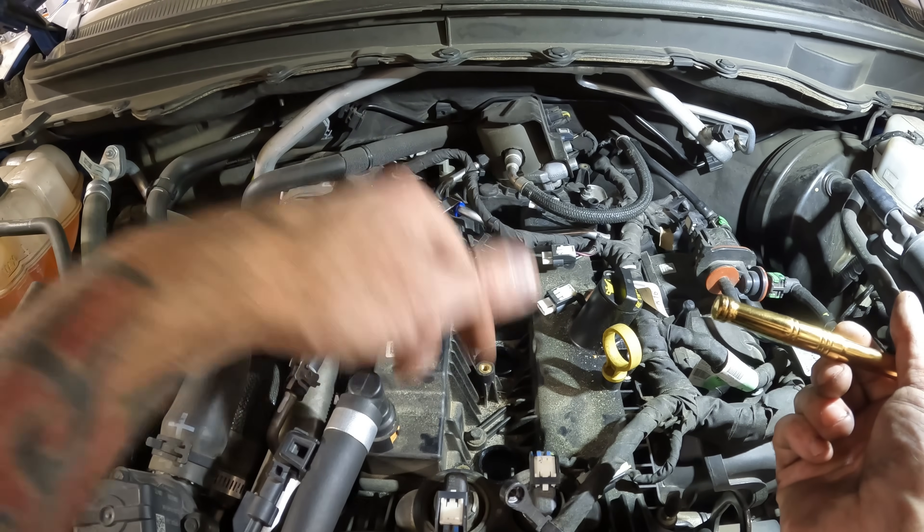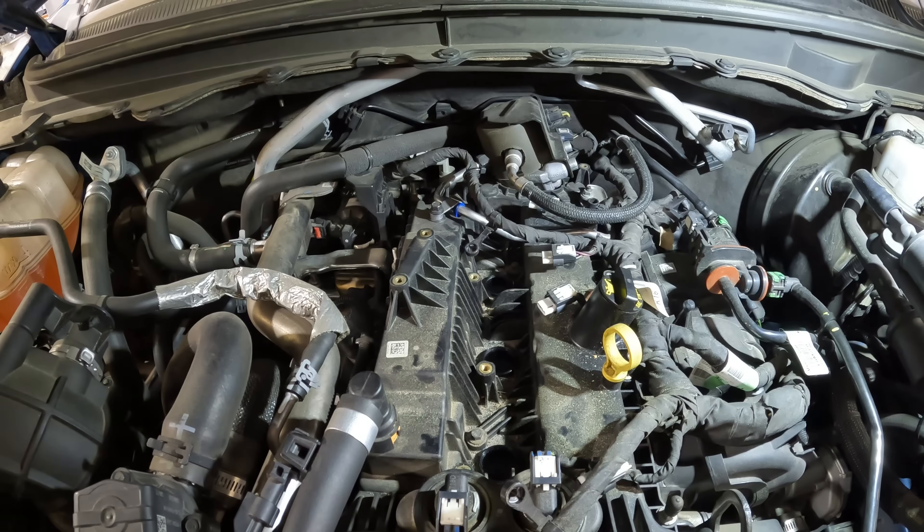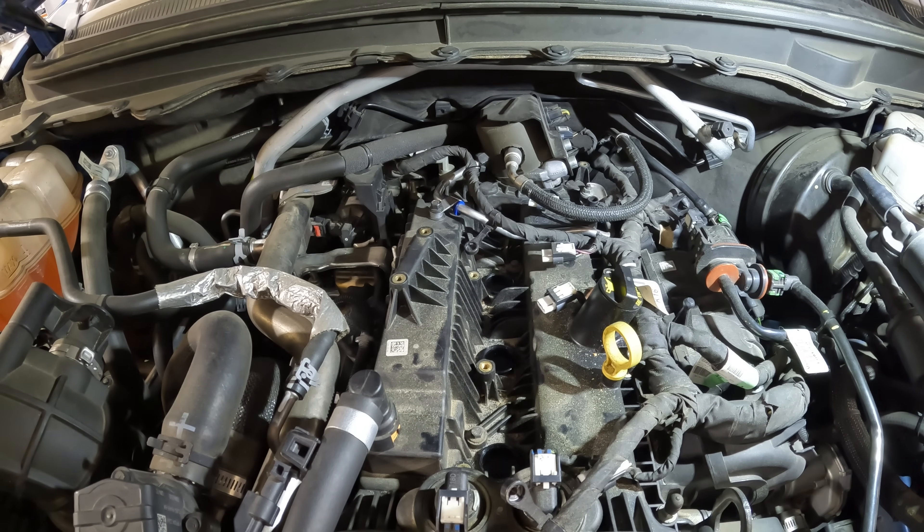Cylinders look pretty good. I'm going to get an air gun and blow all that out before I put everything back together. I just want to say thank you guys — I was actually pretty impressed with how clean that is with 80,000 miles, and Ford recommends replacing them at about 150,000, so a little over halfway there. The products really do work — maintain it, man. I also run high octane fuel, I don't run the cheap stuff. I appreciate you guys sticking around — I love you and I'll see you on the next one.